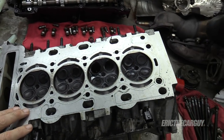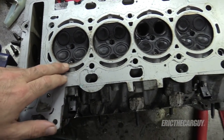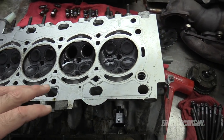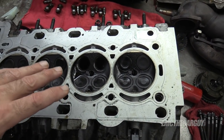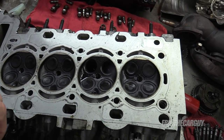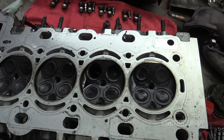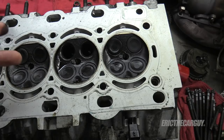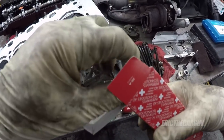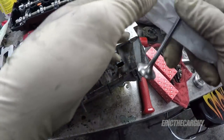I'm going to start here at the cylinder head. I'm going to install the new valves, also clean out the injectors, but mostly I'm concerned with getting the exhaust valves in here. Now, I'm not just going to put the valves in. I also got some valve lapping compound, and I'm going to make sure I lap them in to make sure that they seal. So there's a little bit of buildup here that you want to address. Also, it's just common practice to do that when you replace valves. I'll put part numbers in the description so that you can also find these valves if you need them.